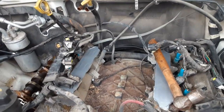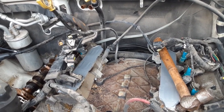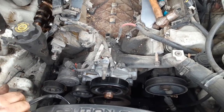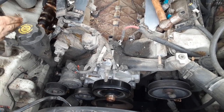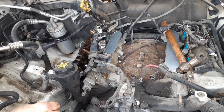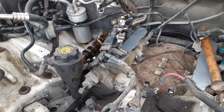Should I start pulling the exhaust? There's a long way to go here, and it's not going to be exciting to watch. Everything has to come off the front — even the pulley down there. With the cam on top of the engine, the whole front of the motor has to come off because the timing chain has to come off to get the head off and replace the gasket.